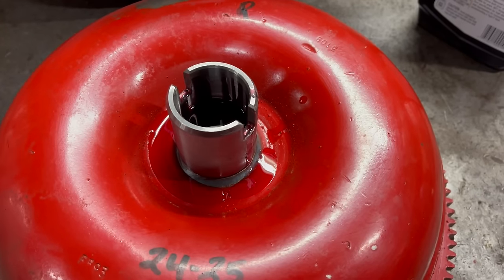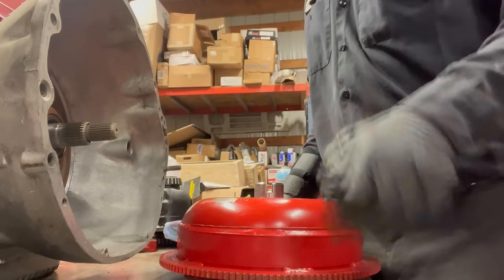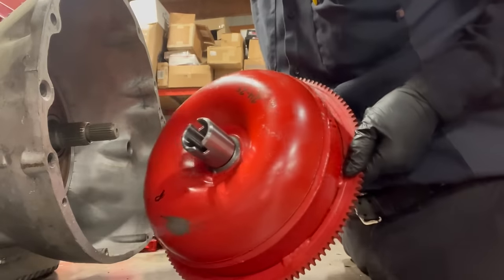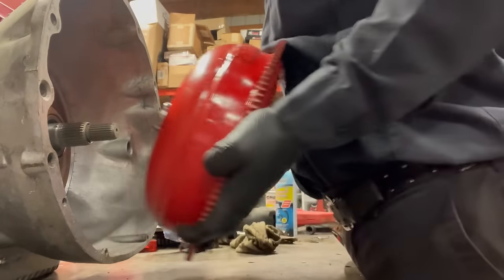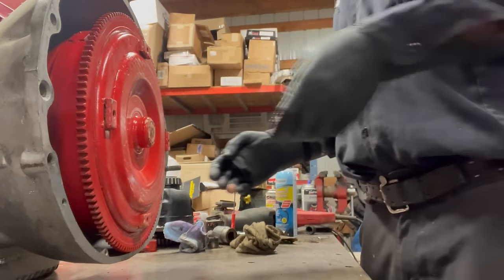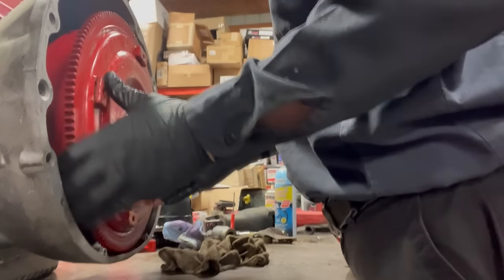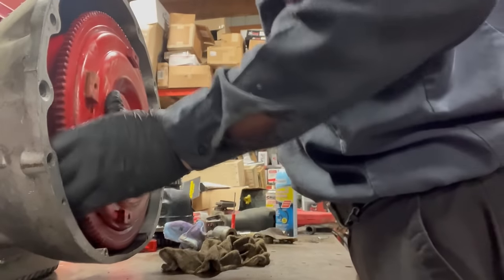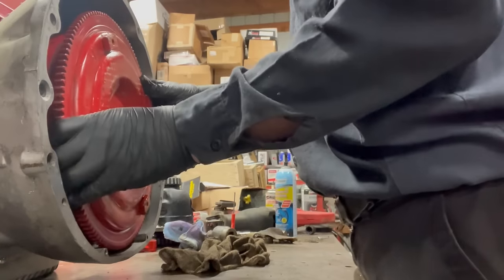You'll definitely make a horrible mess. That's part of it. Let's see if I can pull this off on camera. Probably not. Sometimes they just go right in. Sometimes they're really challenging. Oh, and I got that whole quart of fluid in there. I could keep going, but remember that thing about not having patience? Okay, so we're engaging 2 sets of splines and a set of teeth. One of them will probably just pop right in. That one. Now this involves a good bit of spinning and wiggling.